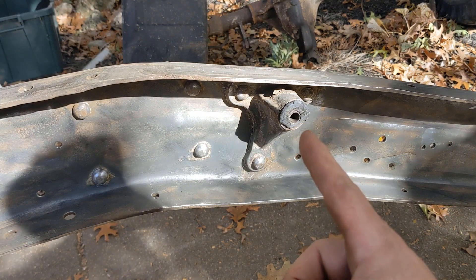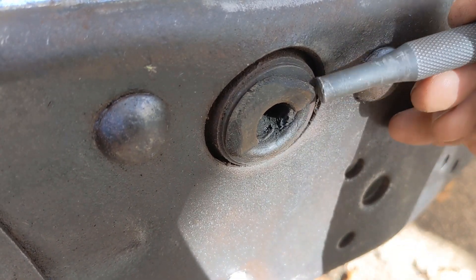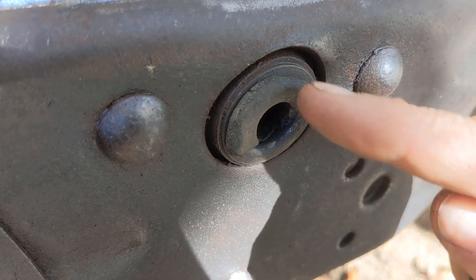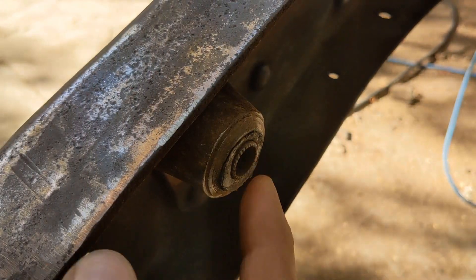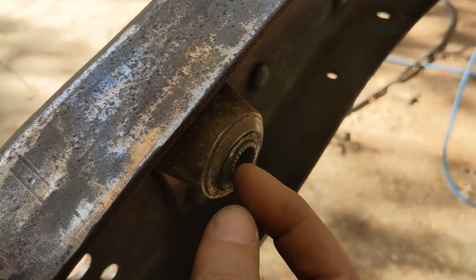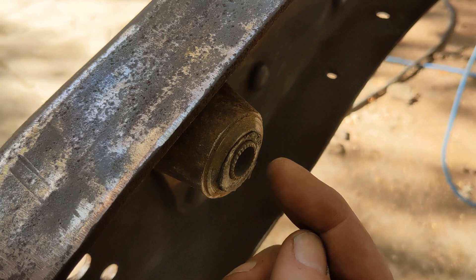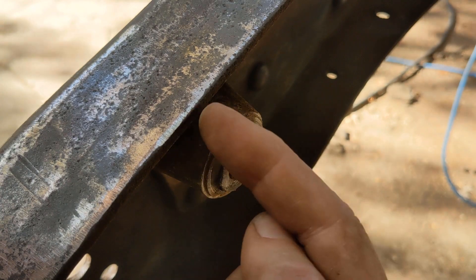The question is how do you get those out? If you look at this one closely, you'll see we've got this rubber bushing here, then there's this shell and it goes into a tube, so you can't just pull the rubber out. This shell has to come out and it's flanged, so it comes out of the hole and then over, so you can't push it in — it has to be pulled out. If you look at it from the inside, you've got the same thing: we've got this flange and then this centerpiece that goes through. So we've got a flange that comes in from each side, so it's actually split in the middle. There are two bushings that come in from each side, so they have to be pulled out or driven out, but from the inside, not from the outside.